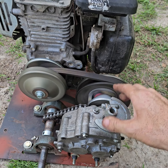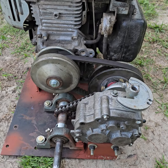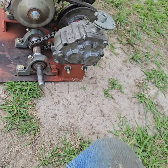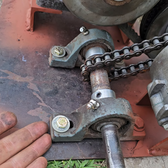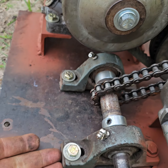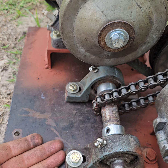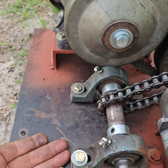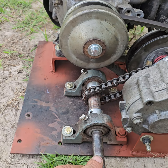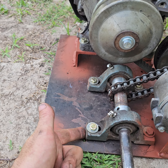Let me go ahead and kill it so I can tell you what I've done to make this happen. So I took a jack shaft — you'll notice I have washers underneath it and shims. As this chain loosens, I'm going to take a washer out and drop the shaft down. What that also means is if it's in a boat or a go-kart, to adjust the shaft height I'm going to have to shim the motor plate up to account for the shims I drop here.